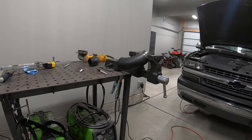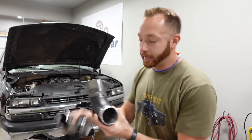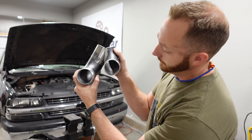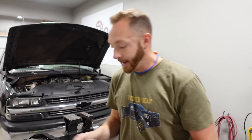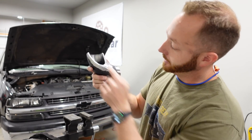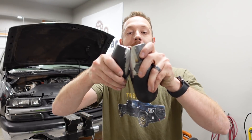I've got the fit-up work complete on the Y-pipe and I'm just about ready to tack weld it together. On the branch of the Y that goes right onto the manifold, I added this 2.5-inch tall extension just to kind of help raise the outermost pipe up and above the frame rail. Now because I added this straight section when I made my slash cut, this half has a nice symmetrical U-shape on it. However, when I made the corresponding slash cut on the opposite side, because it's part of a 90-degree bend, the shape kind of hooks forward and to the front. Unfortunately it doesn't fit perfectly together — it does leave a little bit of a gap on the front side right there. It's not a huge deal; I don't think it's really going to affect the flow of the manifold, and I can easily weld it together so I'm not worried about it leaking or being structurally unsafe. It kind of bugs me that they're not symmetrical, but that's really just the constraints I have to work around. So I guess now all I've got to do is just weld it together.